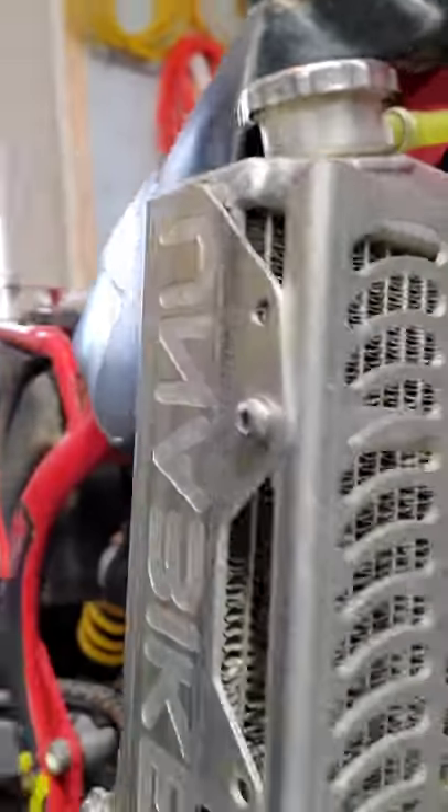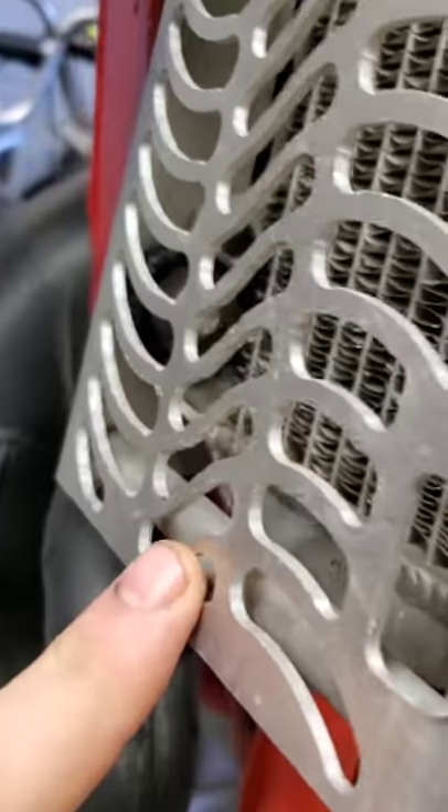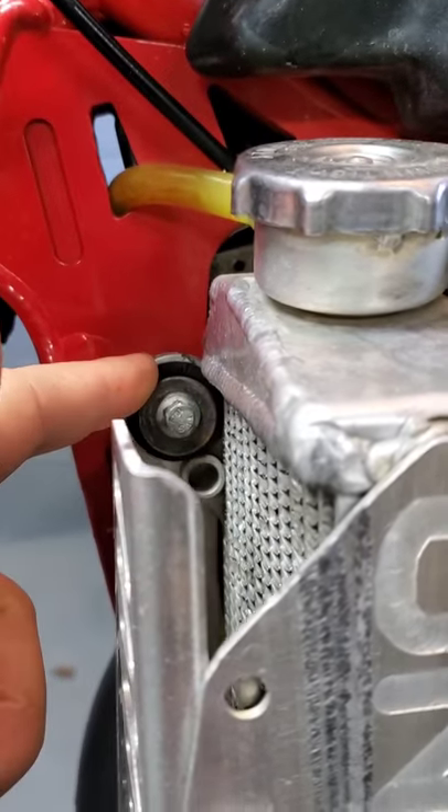So like I said in the beginning of this video, we're going to work on a radiator because my son is a very aggressive rider, and with being a very aggressive rider he crashes a lot and his radiator was crushed. What we're going to do is install a new radiator on his Cobra and put a brace on it. So when he crashes — because he will — it won't crush it. His sister already has the brace on hers. So right here is the brace, and it goes across with bolts that connect. Then the radiator connects through these grommets to the frame — that's how it stays on the bike — and then it has a bolt here and a bolt there.